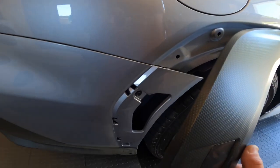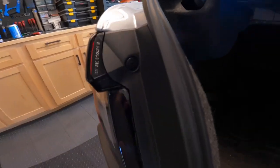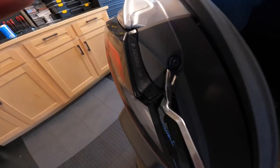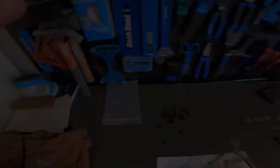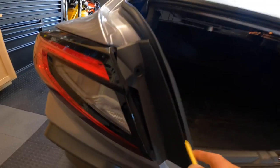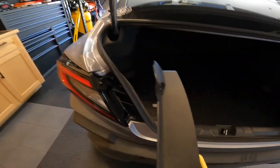This is one thing I made sure I was going to do right, just because I don't want to break a brand new car. But you should just pull these out — and that right there is the screw you want to expose. Your next step is going to be that screw right there on both sides. When I said screw, I meant another pop clip, because Subaru just loves putting these all over their cars. It's a good demonstration of how that tool works, though. Next thing: pry this guy off. Recommend using a little plastic pry tool. Pops right off.